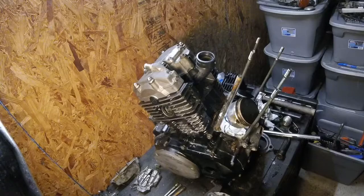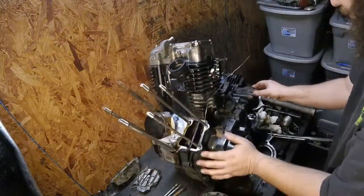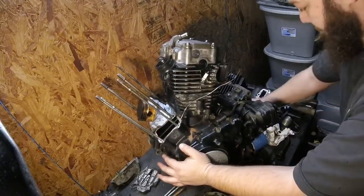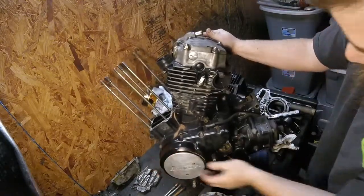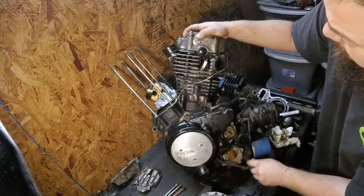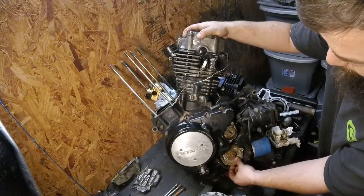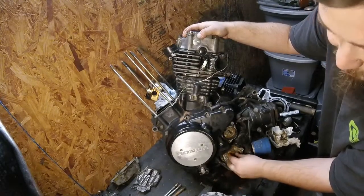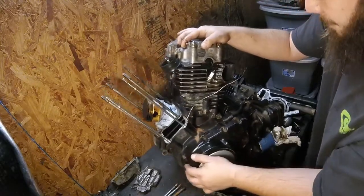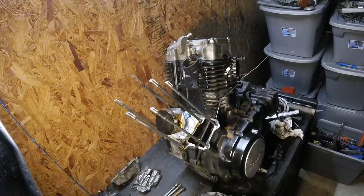Oh, yeah. Another part of the cooling system diagnosis. Y'all are going to love this. I've got a mess here. Look down in that water pump there. See that? Down in that cavity where the impeller goes. Do you see an impeller? No. Here's what a water pump on these is supposed to look like.